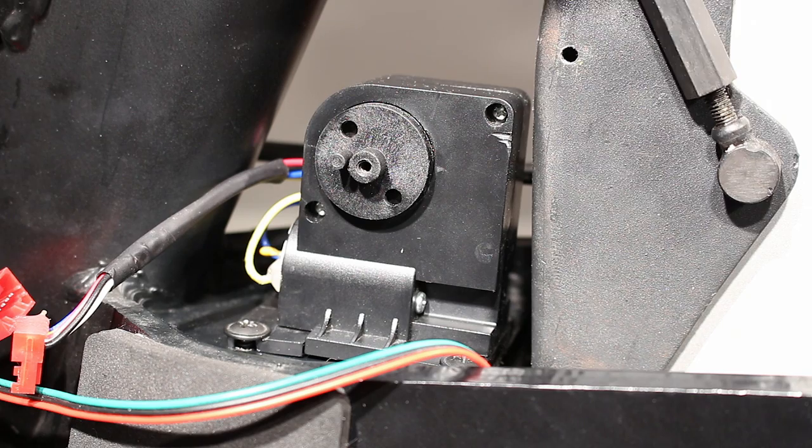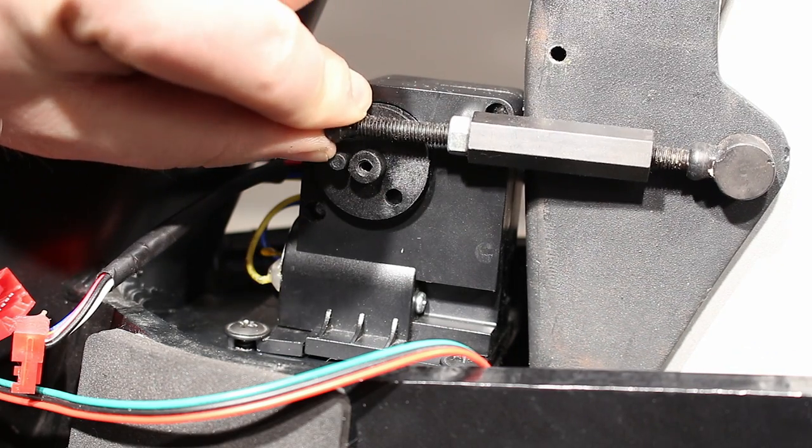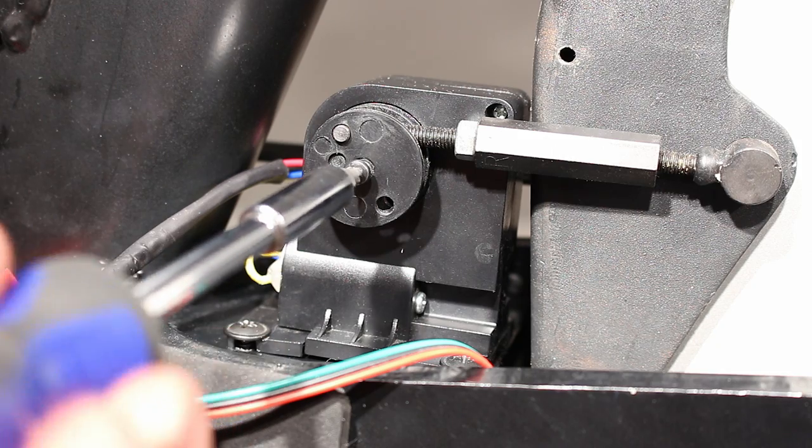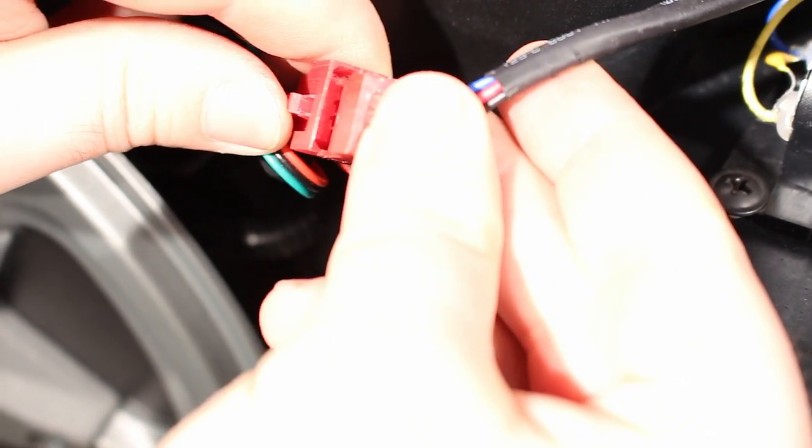Reconnect the resistance link arm to the motor into the mounting hole closest to the disc registration pin. Then, mount the disc and secure it using the small screw. Reconnect the motor wire to the lower wire. The connection should snap easily into place.